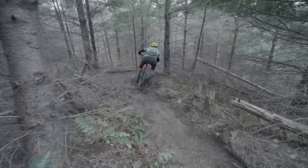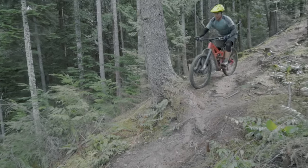This is cool for a couple of reasons. First off, at top out, it looks like the fork offset could be close to 50-ish millimeters. So my HD4 had a 66 head angle with this short fork on the front, and it handles really lively. It's a very nimble bike. It feels great. The magic really starts to happen as you hit the bigger obstacles.